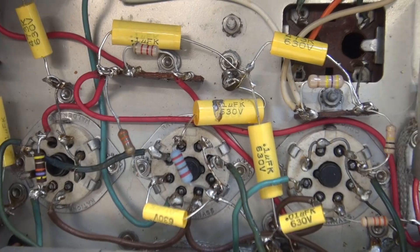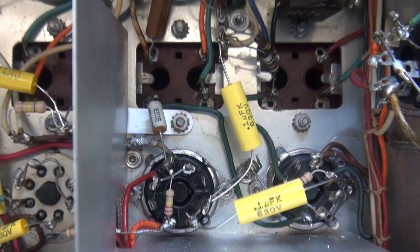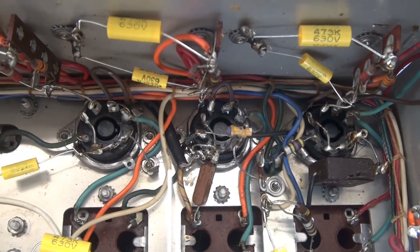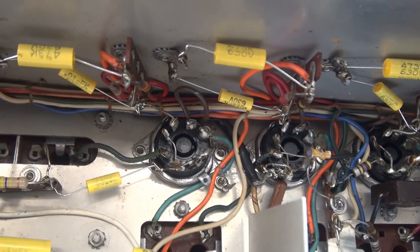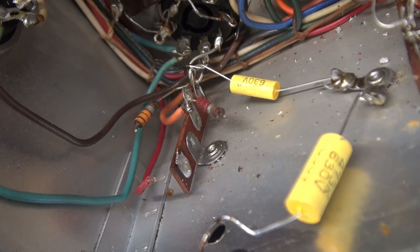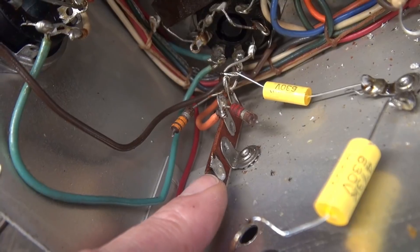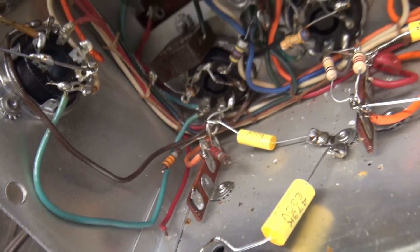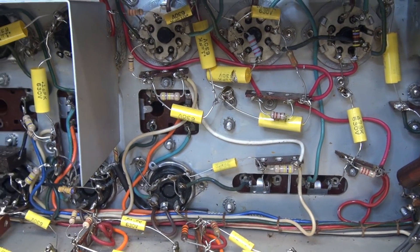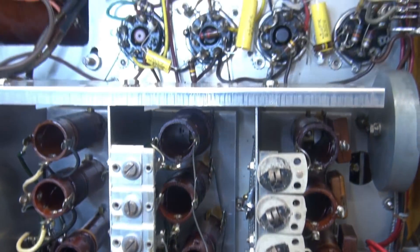Having this chassis removed from the cabinet gives you better access to a lot of these parts that are hidden up in these little cavities. Moving along on the upper cavity — I changed out all those resistors, added for about an hour. It's not too bad of a job. Now I need to swing up here; there are some against the wall of the radio. A lot of them are 2.2Ks, and they're famous for going bad in these radios.